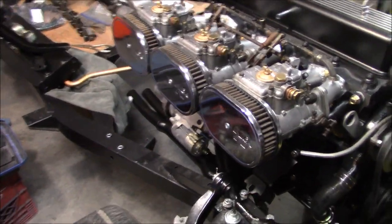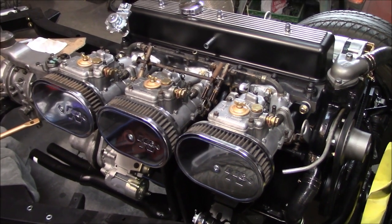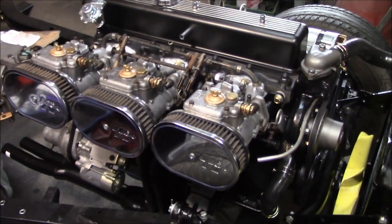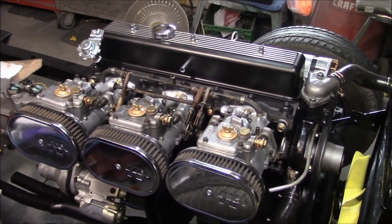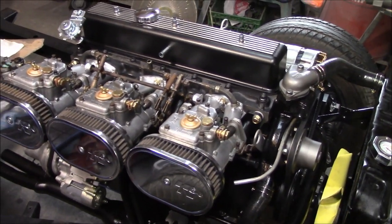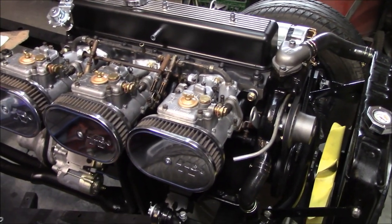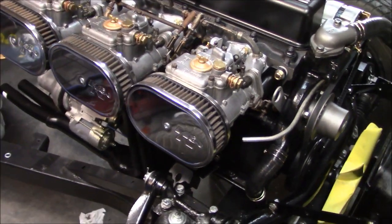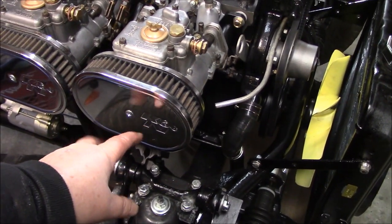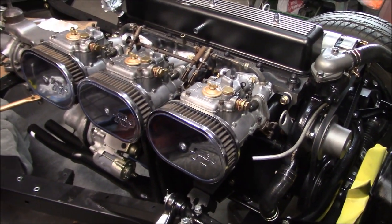One more look at the Webers with the air filters on. The previous owner ran these Webers without any air horns or trumpets on them whatsoever — he ran them straight flat to the bodies with these filters on, and that is not the best thing to do for Weber carbs. So I'm going to invest in some short trumpets, ram horns, or velocity stacks that will fit within these filters. I'll order the air horns at the same time as the fuel fittings. There's not a lot of room — I modified the inner fender and sheet metal of the TR250 to give a bit more clearance for this front carb, and that was just with this thin filter on there.